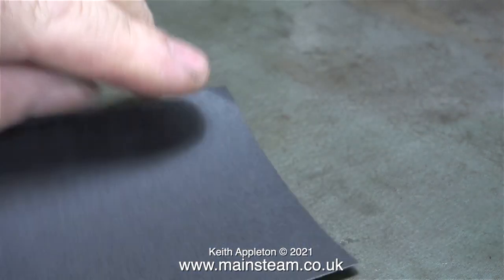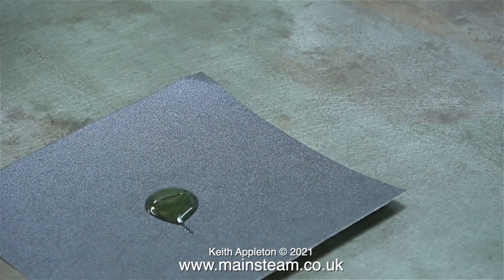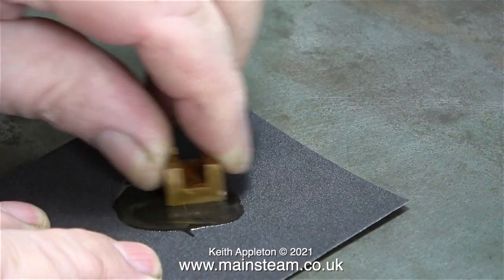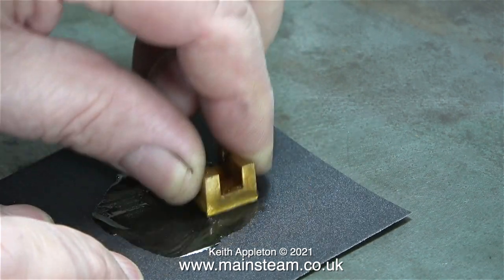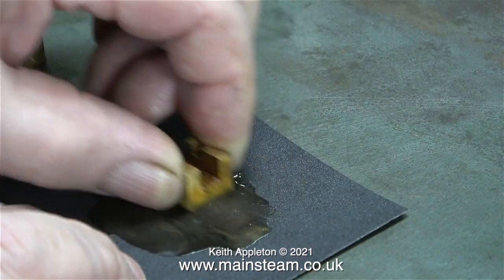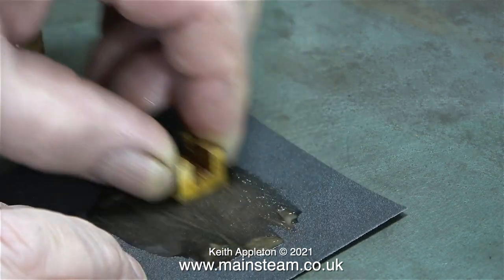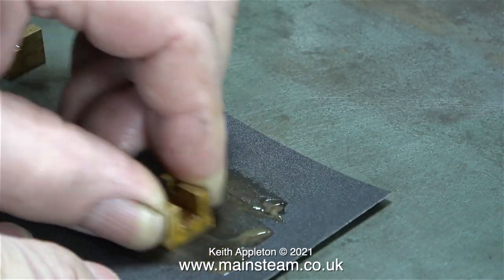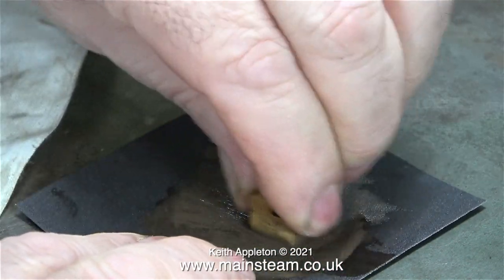My weapon of choice is a piece of 400-grit wet-or-dry sandpaper — and it's neither wet nor dry, it's oily. I normally put a spot of oil on just to help the metal cut. This is an incredibly boring video, I can't do anything about it. I try to show how I do the jobs and this is part of doing the job. I have to get rid of all the scoring from the valves on the port face, and the scoring is quite deep. I'll edit this down to a fraction of the time it actually took.